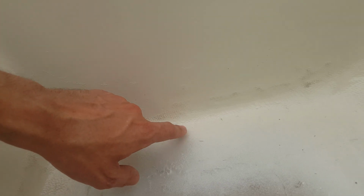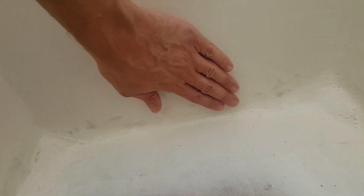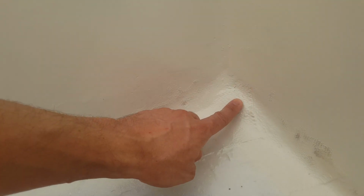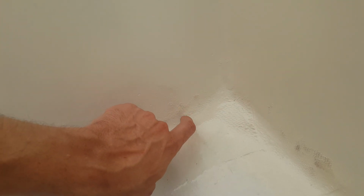So what ends up happening is if you try to lay Kevlar as flat as you can and you try to sand it to make it nice and smooth, so when you go to apply your gel coat over this, you don't have all these bumps from the Kevlar in there and these little pieces. It's almost impossible to get away from that.